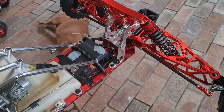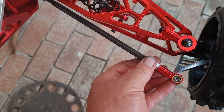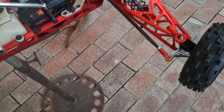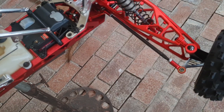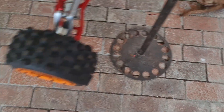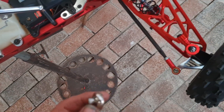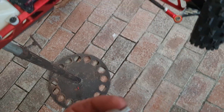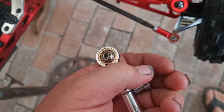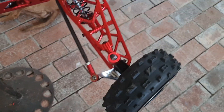There are a lot of things you actually find, but there's a lot of slop. Apart from changing the whole steering system to the other setup, I'm going to go out and buy the rose joints — 6mm male and female — and take the insert out of these turnbuckles; they come as a kit. That'll fix your problem and stop the slop.